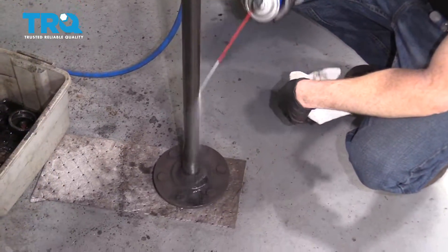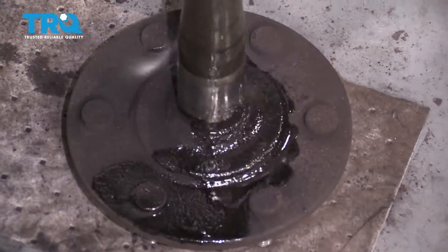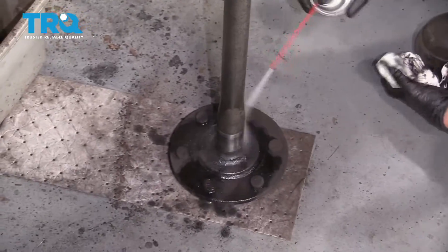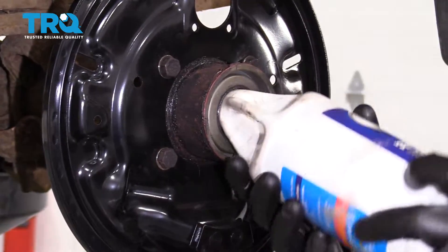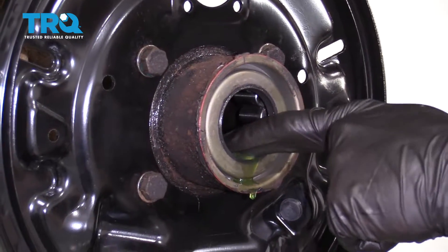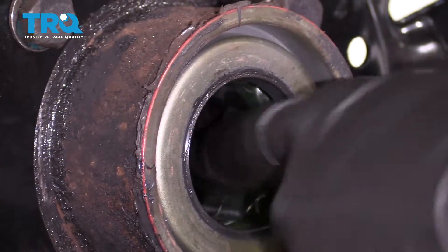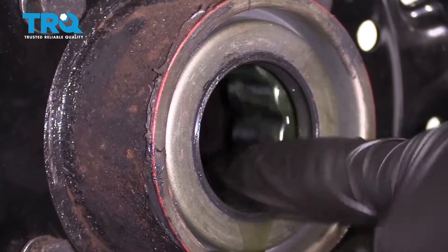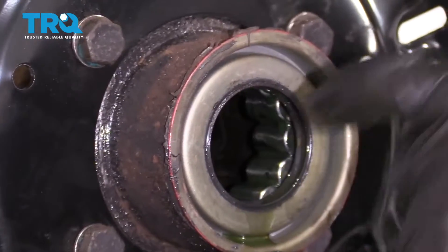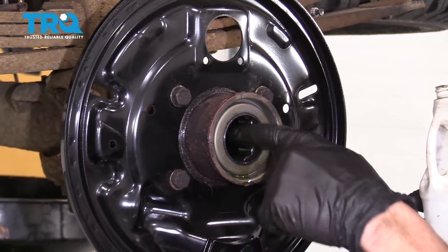Make sure you clean down your axle shaft, and especially right down here — this is where the seal is gonna ride. For this application, we're gonna be using 80-90 gear oil. Put that right in there, make sure we've got our catch bucket. Once you have plenty of gear oil inside, just rotate it around and around — you wanna make sure all these bearings in here are sufficiently coated. If you want to add a little bit more, that's fine. Some people will say to keep adding so it goes down the tube — that's completely up to you, because when we're getting closer to being done, I'm gonna show you how to fill this tube anyway.